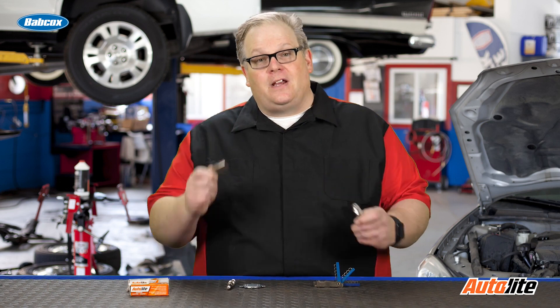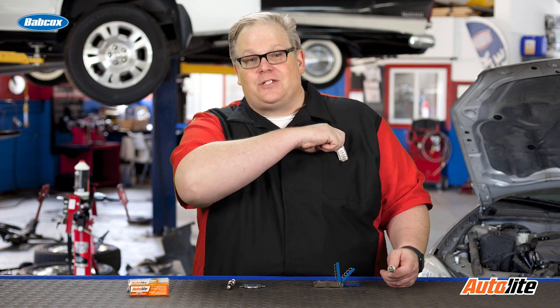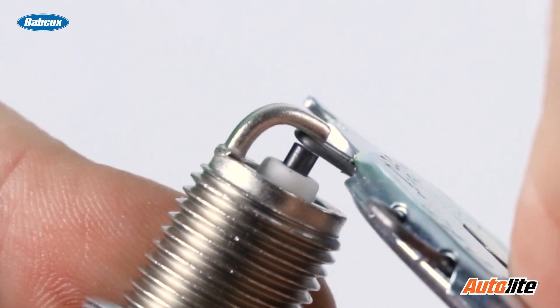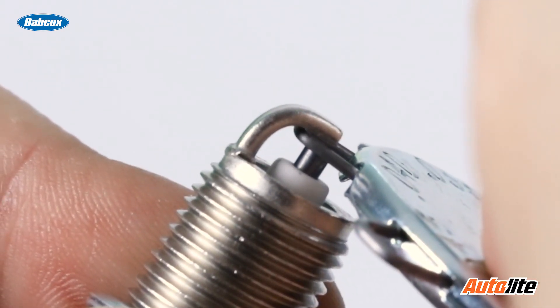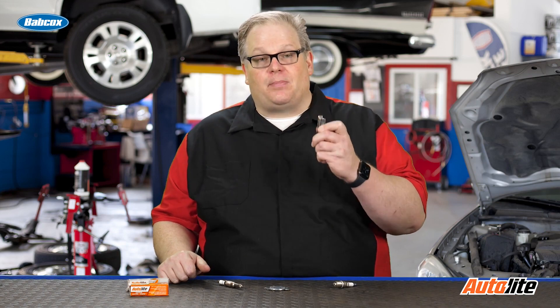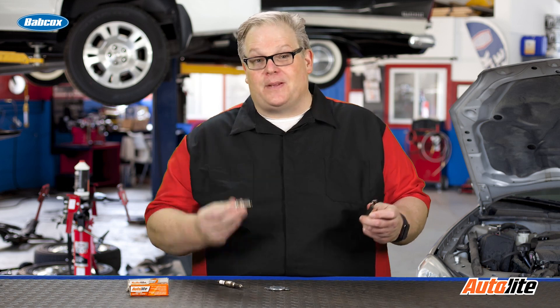You're going to have to do it on some spark plugs and this includes some fine wire plugs. So make sure that you're using the right tools. If you're using one of these wedge style things that are designed to fit in between the electrode with a ramp, they could possibly damage that spark plug and it's critical that you don't use these. If you're dealing with a copper core or a fine wire spark plug, make sure you're using a wire style gauge to measure the gap. This way you're not going to be damaging the electrodes, and chances are on one end of it, it has the right tool to properly bend the strap so you're not causing damage to a very expensive spark plug.